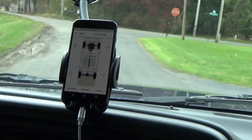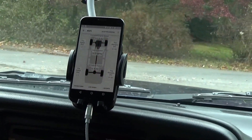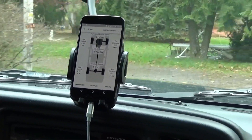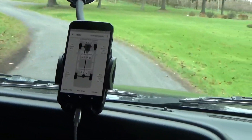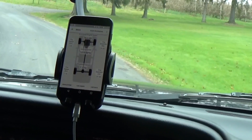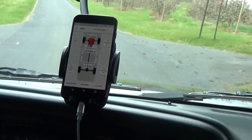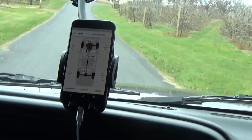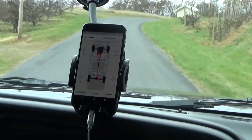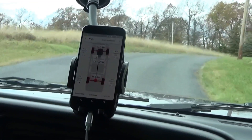The app detects first, second, third, and fourth order vibrations. Go to Professor Kelly's page if you want the full explanation, but my understanding is: a first order vibration means it happens once every rotation, so you feel it every single rotation. That makes it worse than a second order. It gives you a starting place to find your problem.